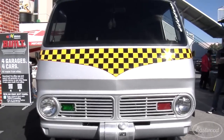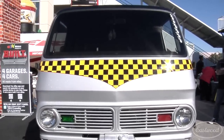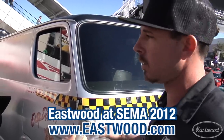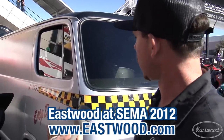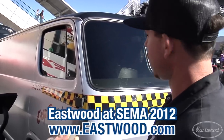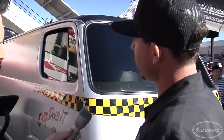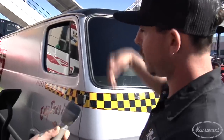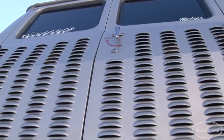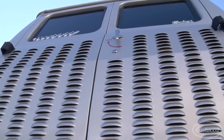On the front end here, we shaped everything. There were the vents, the windshield wipers, all that stuff — we got rid of all that and made new panels. We did a lot of lead work up in the A-pillars, and a lot of that was using the lead equipment that you guys sell. On the back of it, we did louvers. The inside is all aircraft-themed.